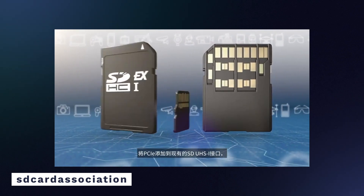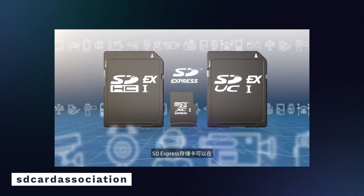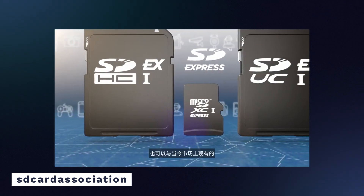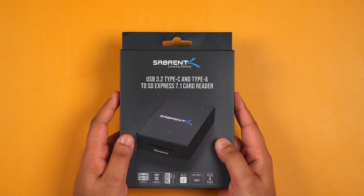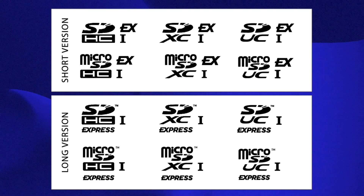The full SD card sizes will have the same layout as the current UHS-II cards. This form factor may support a single lane of PCIe Gen 3 to achieve those 985 MB per second speeds. However, these cards do not support the UHS-II interface and only support the UHS-I interface. This still ensures backwards compatibility with thousands of card readers and devices, but will be limited to UHS-I speeds. Therefore, you will need a specific SD Express 7.1 compatible device and card reader in order to make use of those blazing fast speeds. Here are the new markings to look out for when shopping for SD Express 7.1 devices, cards, and card readers.